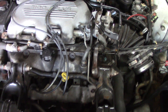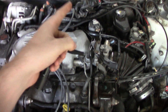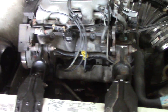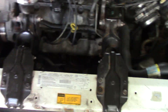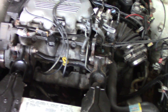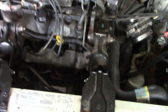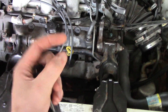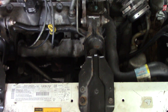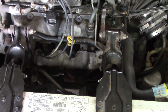The next thing I wanted to do was diagnose the three most common things up front: the coil pack, the spark plug wires, and the spark plugs. I pulled the spark plugs out of the car and they are almost all brand new — high quality AC Delco spark plugs, not the cheap version. They have what looks like a platinum tip, not worn down at all, and they still even had anti-seize thread locker compound on the threads, so definitely recently replaced. I knew the spark plugs weren't the problem and put them all back in. I did notice that the spark plug on one cylinder was dirtier than the rest, so I cleaned it off before reinstalling it.